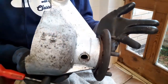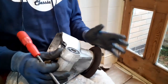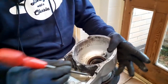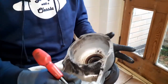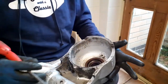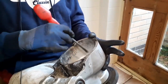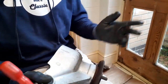At least I've got that open now. I'm going to continue to give it another clean - I'll give it three or four cleans. I've reused and recanned the original solvent; it won't matter for a first clean how filthy it is just to get the worst stuff. I've sieved and recanned it. Now I'm going to use completely fresh fluid, scrub all this out and re-can that. I'll do it three or four times until this whole thing is completely clean. Then I'll use the hair dryer to blow away any residue of solvent - I don't want any solvent left behind before I repack the grease.